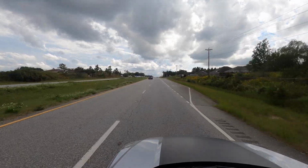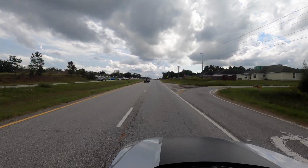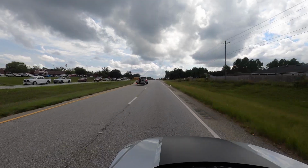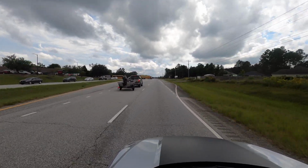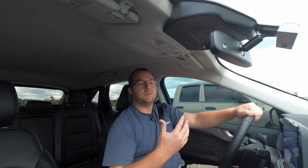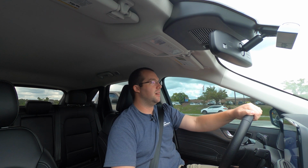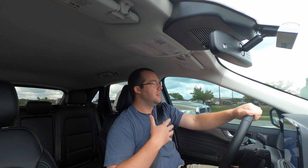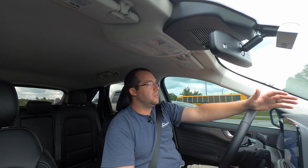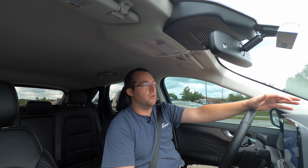Then you take it to the next level with our adjustable toe links that we engineered and designed on this vehicle, will be available on the website as well. Those adjustable toe links allow you to dial in the rear toe to again further enhance the overall driving experience. If you do a lot of, not canyon roads, but like mountains and lots of turns and twisties and things like that, you really do get to enjoy the driving experience a little bit more.